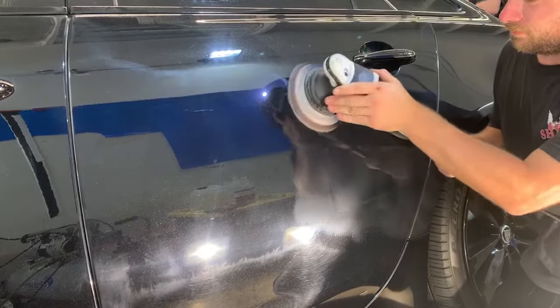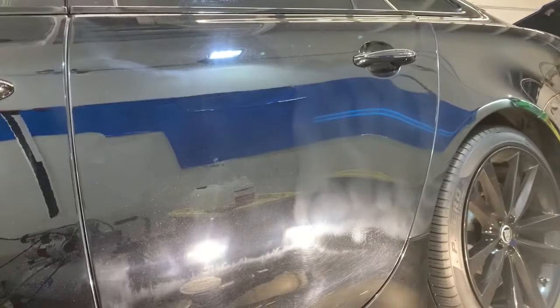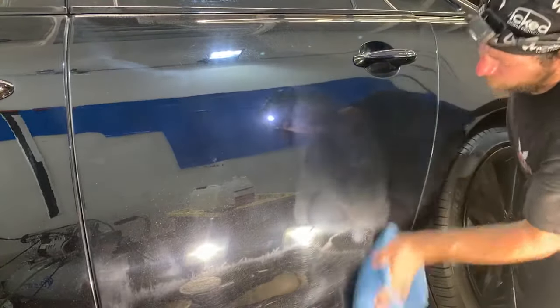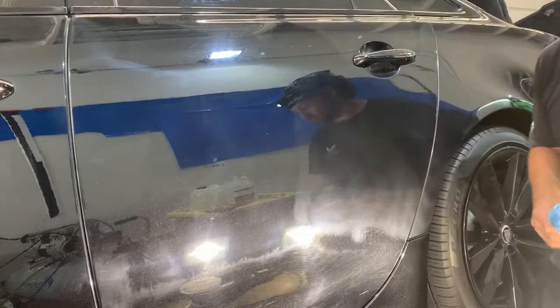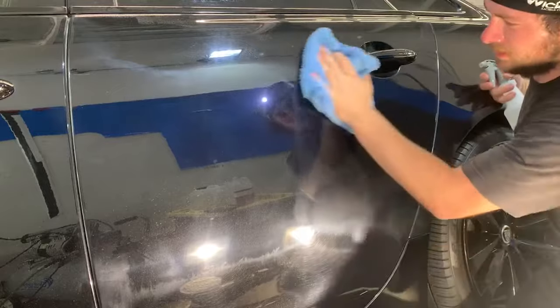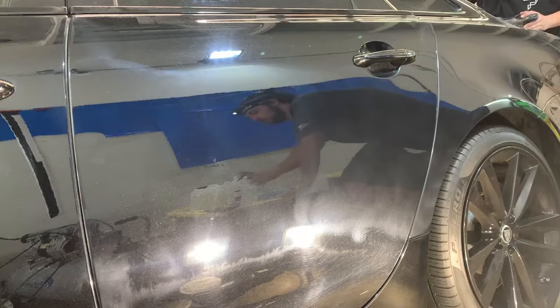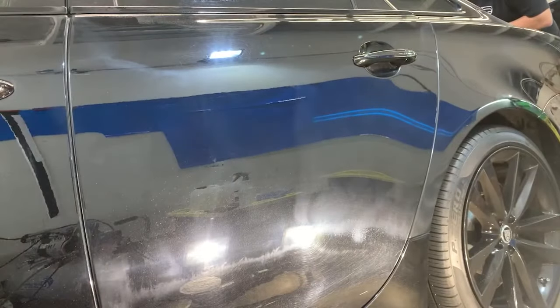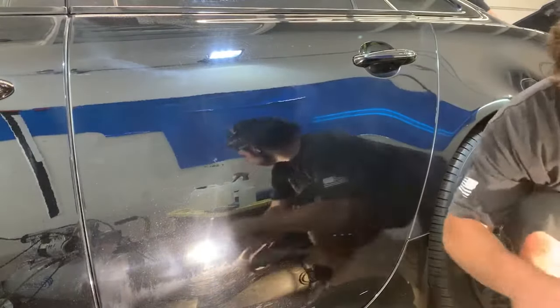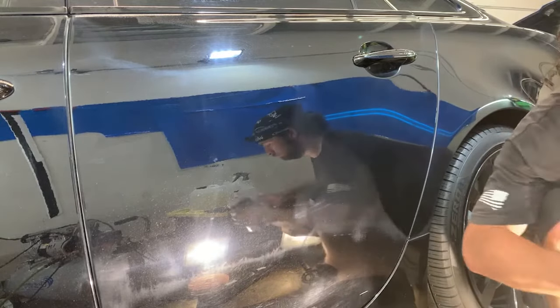You may need to tell your customer that you can only achieve a certain finish without getting a crappy look. Cars like this make the day longer. Right around the door handle I was unable to get all the residue off because I couldn't get my foam pad to fit there, so I had to carefully polish by hand using just the edge of a towel. Spritzing with water did absolutely nothing here. You can also try a damp towel or quick detail sprays like Shine Supply Shine Mist.